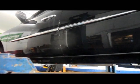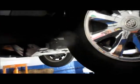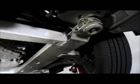Okay, today we have a 2005 Buick LaCrosse with a 3.8 liter engine, and we're going to be changing the oil and filter. I just want to show you where everything is located. Obviously, we're going to lift the car up on the lift, or we're going to put it on some floor jacks or something like that. But this is where the oil drain plug is. It's about dead center of the car.